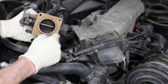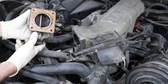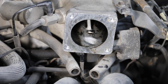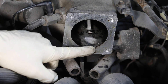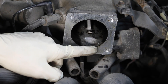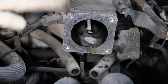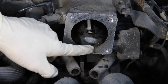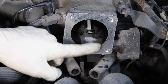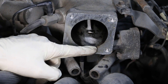What I'm going to do today is clean up all around this throttle body so that as I'm accelerating, it's allowing a smooth airflow, and as it's idling, you get a really nice smooth airflow into the engine. I'm going to provide multiple angles so you can see what the seafoam has done. If you look at the bottom of this intake, all the way down the aluminum, it is extremely clear where the seafoam has dissolved all of the carbon deposits. On the sides, the carbon still exists because as the seafoam was getting sucked into the engine, it was remaining on the bottom side of this intake manifold. I just wanted to provide definitive proof that seafoam has done a tremendous job at dissolving the carbon deposits.